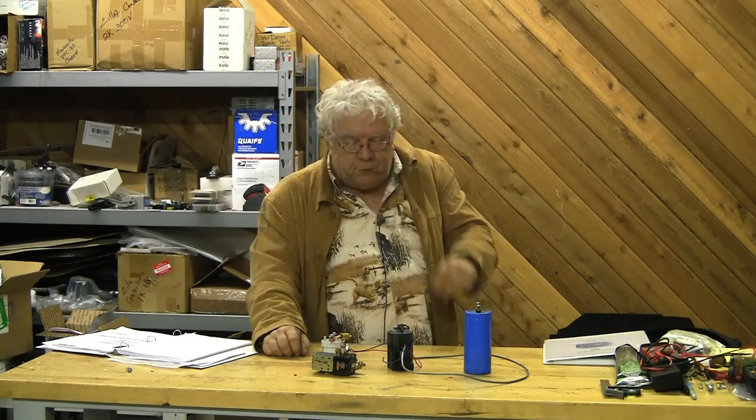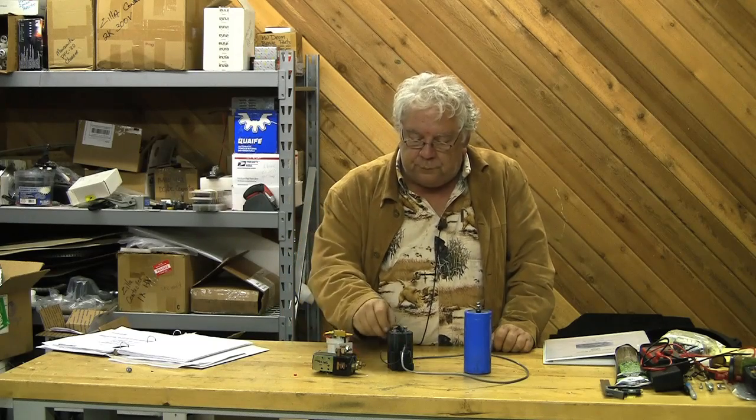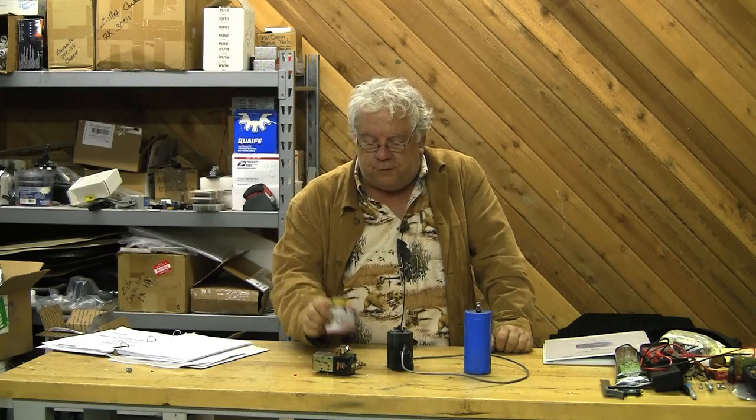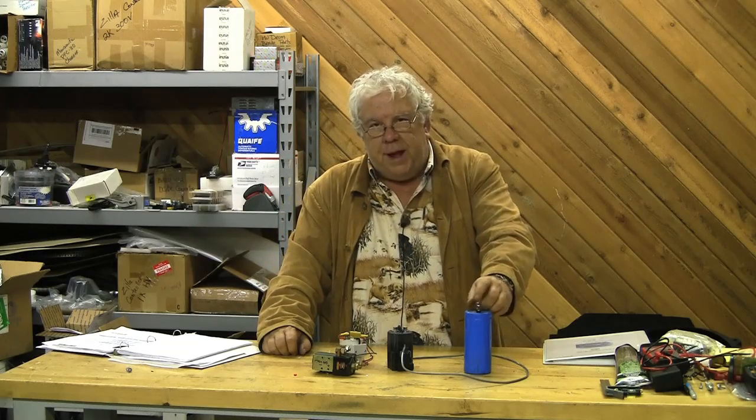We had to send it back in outside of Switzerland. So to protect your equipment, you do need a pre-charge resistor. If I'm turning the car back on, I make sure my switch is off so this is open. I turn on my maintenance switch or emergency disconnect and give it three or four minutes — I'm usually not in that big a rush. That gives capacitors time to charge and avoids those huge inrush currents.